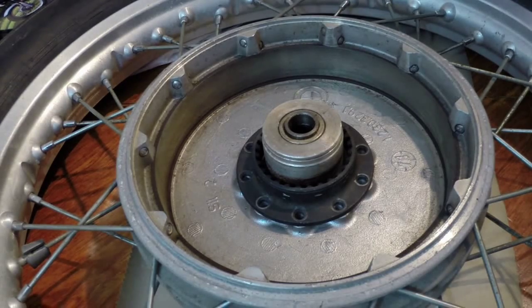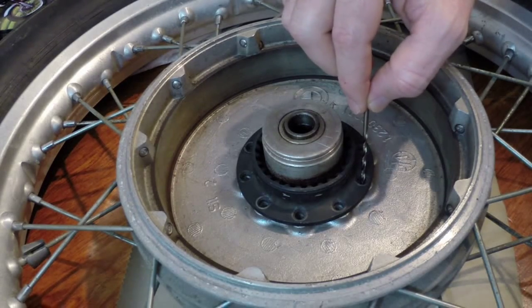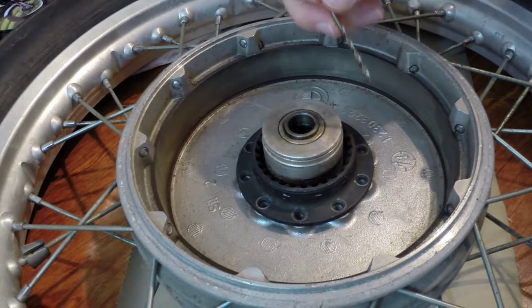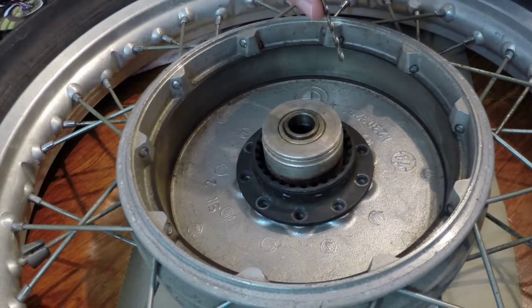Use a 1/8-inch drill and drill as straight down into the rivet as possible, about a half inch. I recommend using a level and leveling the hub on a table before you start drilling. If you have one, use a drill with a bubble level on it, because you're going down a half inch and if you go in at an angle, you're going to end up doing damage going into the aluminum. You want a high quality drill bit — I recommend using cobalt drill bits. They're fairly expensive, but you definitely do not want to break off one of these drill bits in the steel rivets. You'll just be making a simple job a lot harder.